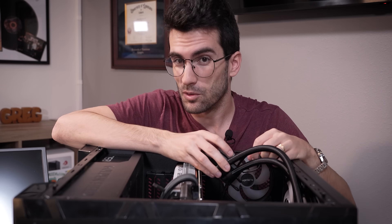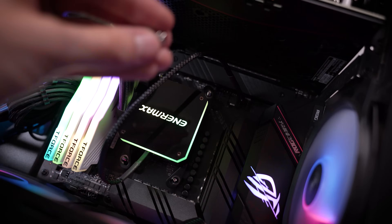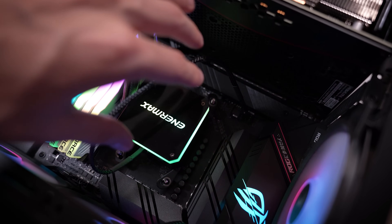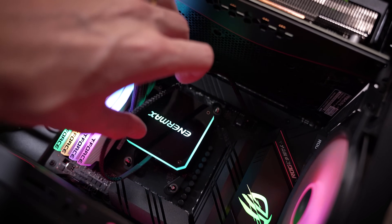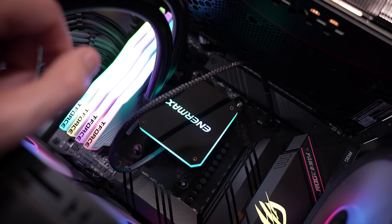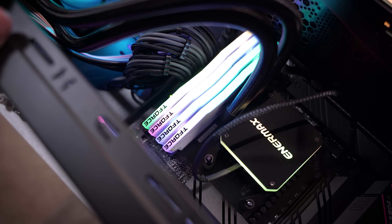With the block torqued down just a quarter of the way across all four screws, we just get the hanging CPU debug light. If I torque down any further, in most cases no lights show up at all and the rig just refuses to post. And look — there's the boot light, there's the green one. That is with no standoffs or no screws over the CPU block standoffs. It obviously can't run like this long term. I think what happened was when he took this off, it was a bit tough to do so — he was twisting a little bit and kept pulling, then pulled hard enough to where it just pried off really fast. He said the CPU was still in the socket so it didn't get ripped out, which is pretty common with AM4, but it did take a lot of force and didn't sound too good. So it's possible the socket was damaged when he did that, and that's why we're having these really finicky boot issues.